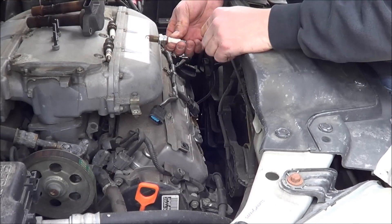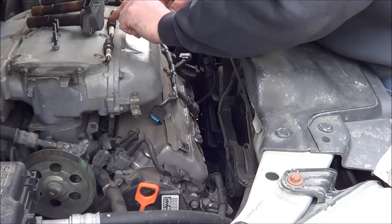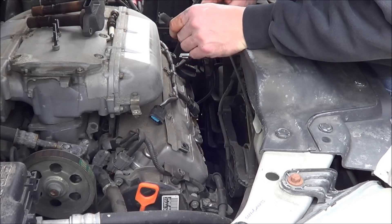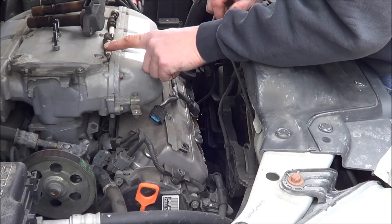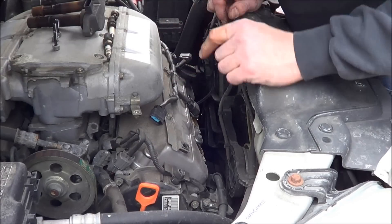Okay, so we've got cylinder six — looks beautiful. Cylinder five — it's kind of crappy. Cylinder four looks definitely crappy from the plugs being loose. I hope those threads aren't hammered up. Alright, so I'm going to clean these plugs up, put cylinder four's plug into cylinder six, and put coil five into cylinder five, and we'll see what happens.